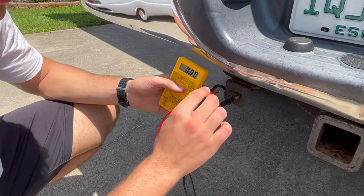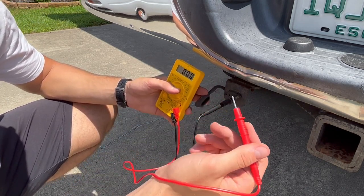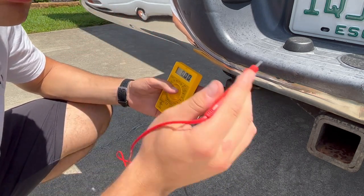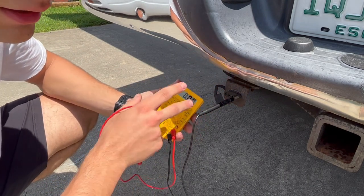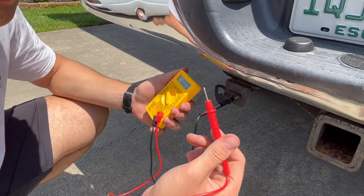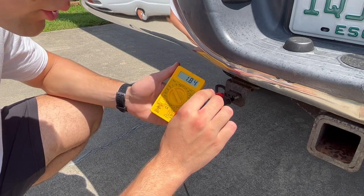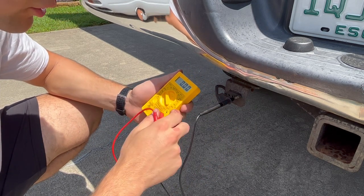This is weird. I just had the hazards on, got the middle pin to read, but the left one — which should be the other blinker — wasn't reading. So I tried just the left one and just the right one, and I noticed that when I had the right blinker on I could hear this little switch module up here for the trailer connection clicking. But when I had the left signal on, it wasn't doing that clicking. I put the hazards back on, took them off, and now it is working. I love these intermittent electrical problems.